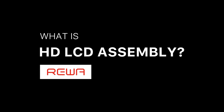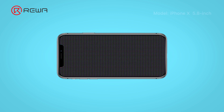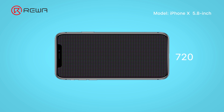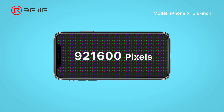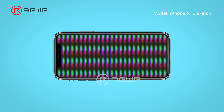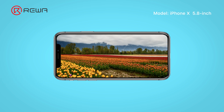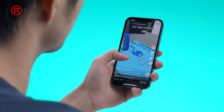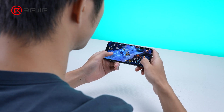What is HD LCD Assembly? HD stands for High Definition and refers to a screen resolution of 1280x720 — that is, the screen has 720 pixel dots vertically and 1280 pixel dots horizontally. PPI stands for the number of pixels per inch. The higher the PPI value, the higher the density of the display and the higher the fidelity. HD screen assemblies on the market have a PPI of around 300, not much different from the 326 PPI of original iPhone HD screens. In addition to the PPI value, the viewing distance also affects the actual perceptual difference, and this should be assessed considering real-world usage.